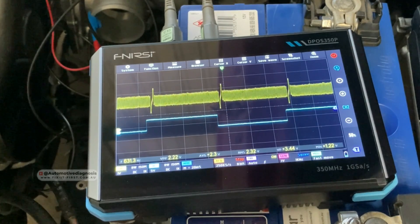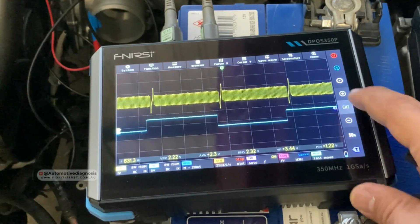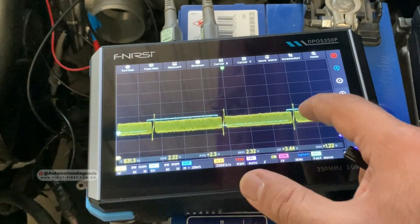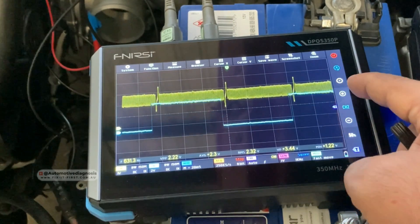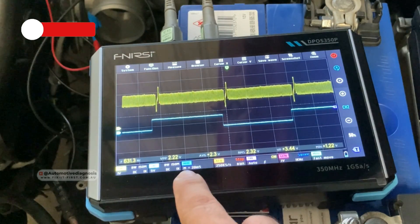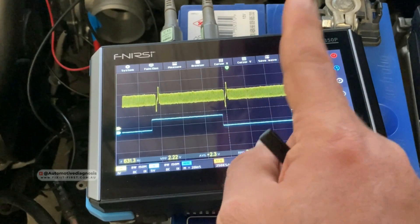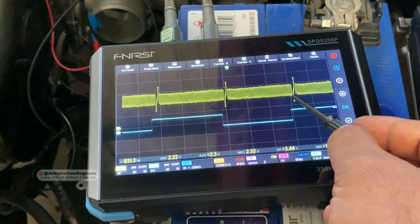So far we are capable of reading the full cycle. You can of course adjust the voltage for each channel — if you tap here you can switch to channel one and adjust the voltage to make the waveform taller or shorter. If you click on channel two you can do the same thing. From here you can also adjust the time setting based on the waveform you're getting. Right now we have the time setting set to read one full cycle of the engine.